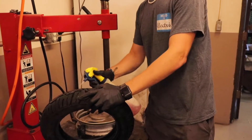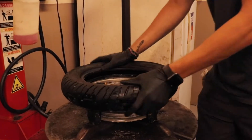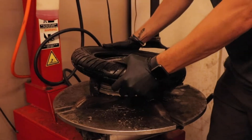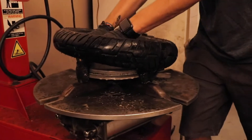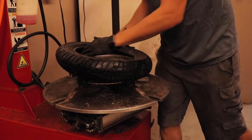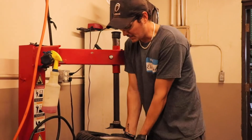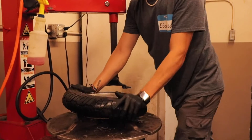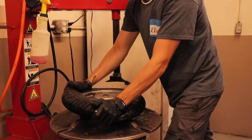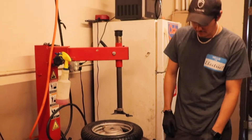Go ahead and lubricate the wheel and rim - that'll make your life a lot easier. This first lip is pretty easy - you're just trying to get that bottom lip around the top of the rim. A lot of times you can do this by hand. I like to do the smaller tires by hand anyway - just walk my hands around. I can literally do this one by hand just because it's nice and lubricated and the rubber is willing to work with me. If you have a really tight rubber sometimes it won't work as easily. We should be on - we can go ahead and release and inflate the tire.